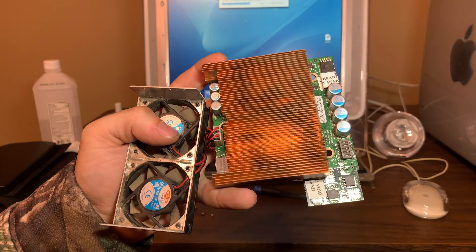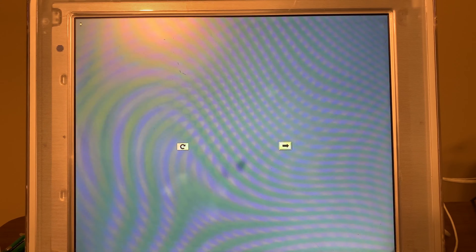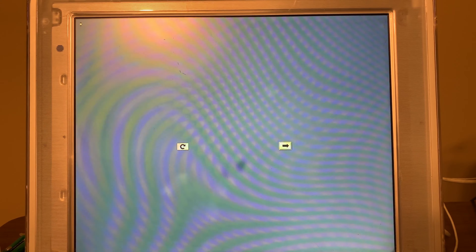Well, it was almost finished updating and the operating system froze up — and guess what guys, the second hard drive I've lost this week. Love working with vintage hardware. I'm going to have to pull a hard drive out of another Mac just so we can run these benchmarks. It's not seeing this drive now — you can hear it, the head seeks across the disc and then goes back, and that's it. The hard drive died on me right when I finished updating Tiger.